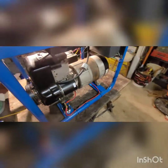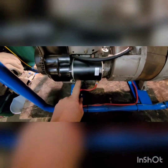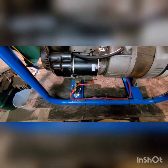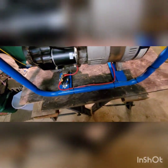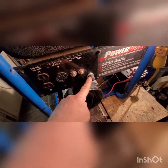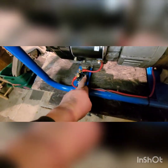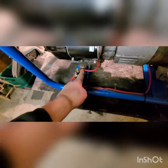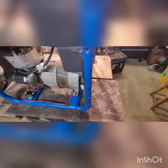I ordered a kit — came with the starter. This unit has four mounting brackets for this particular starter, and I got it on Amazon. The kit came with a solenoid and also a push-button starter, which I drilled a hole and installed here. It's a two-wire starter, and I ran one wire to the solenoid — in and out goes to the starter and to the battery.